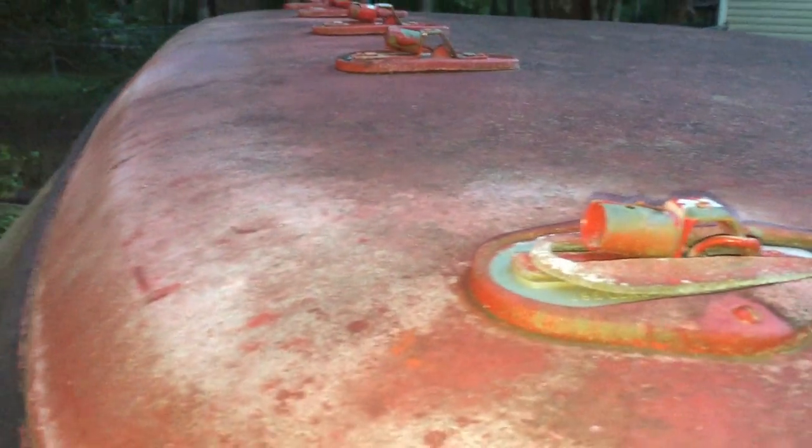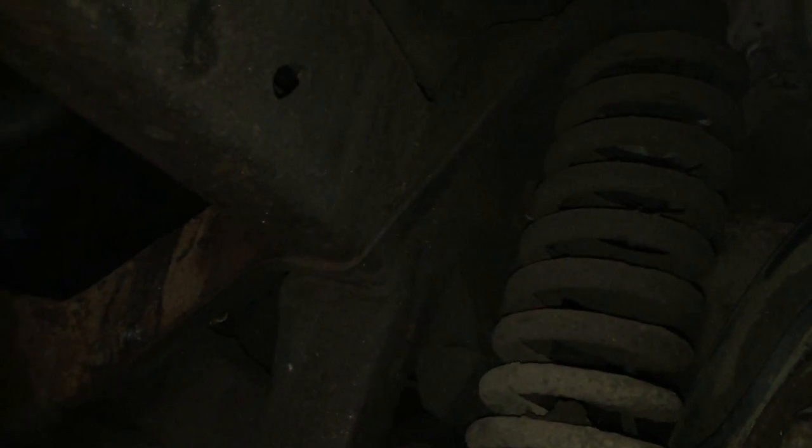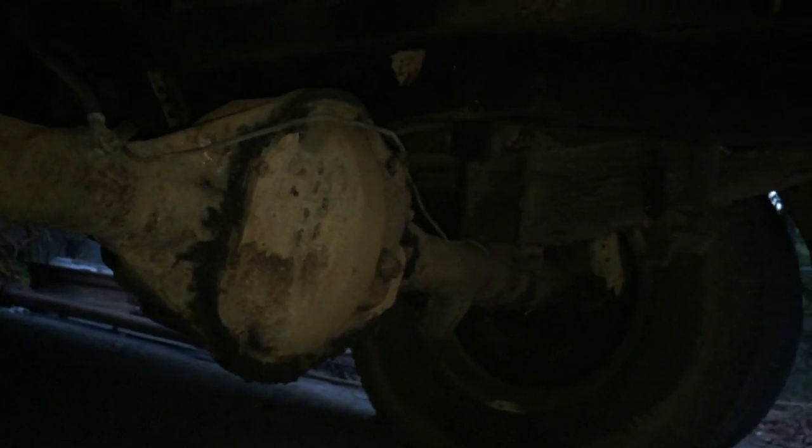So I am not a Ford guy. These are the lights I'm going to replace — they were obviously painted over. I do have the lenses, four out of five, so if anybody wants them let me know. I want to find the big rig style mirrors that go right here — that would totally fit the 1970s profile. I'm trying to figure out: is this an F100, or is this an F100 body put on another truck chassis? It's got pretty good sized brakes, dual pistons on both sides. It's got a 351 in it, I think. And it's got a four-speed because it's got a granny gear. The rear axle — it's got a one ton rear end, that's probably a Dana 60 or 70.